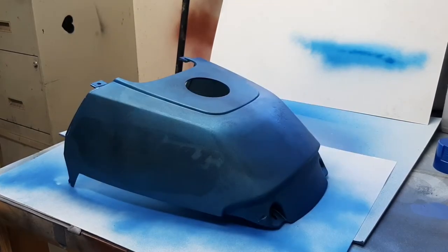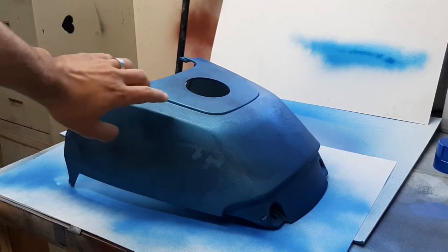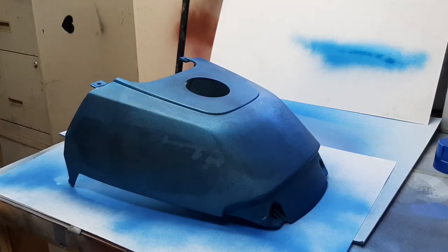I'm going to let that flash and put the next coat on. I'm going to apply the second coat. It says to wait for it to turn to a matte finish, like it is here, or five minutes between coats. I got my fan running so I don't die in here. I'm just going to throw the second coat on real quick.